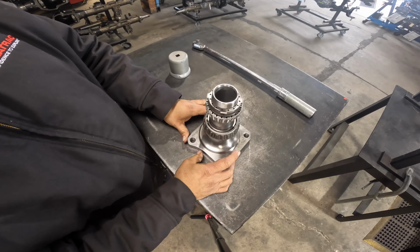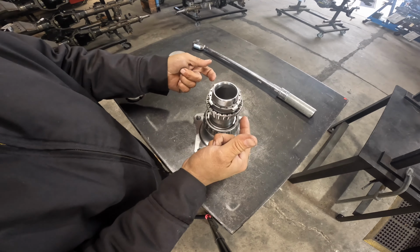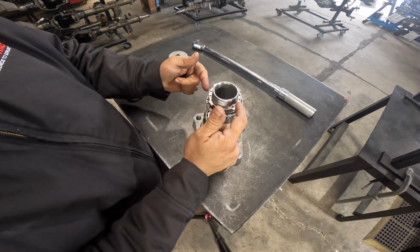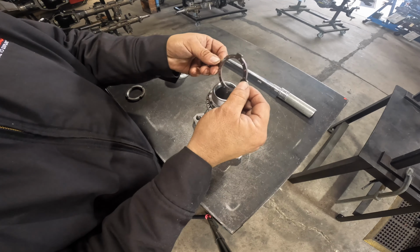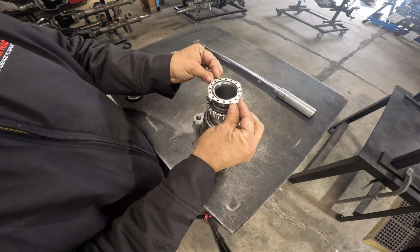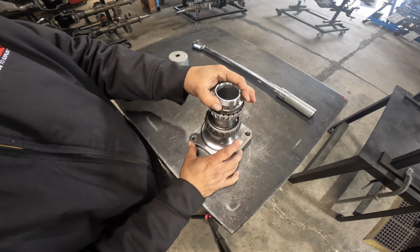It's here. So one trick we can use is flipping this washer. Remember, these holes are not symmetrical. So if I grab this washer, remove it, turn it 180, and set it back down, it might line up. That time it didn't.